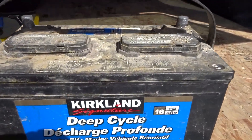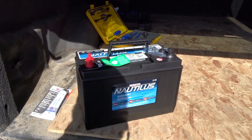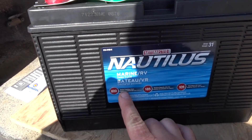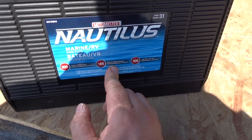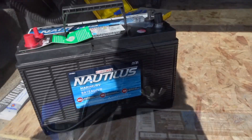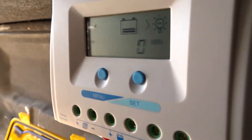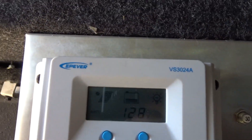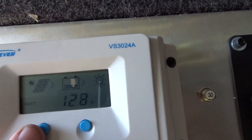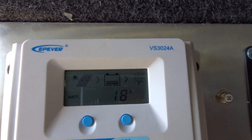That little battery treated me well, but time to get a new one. We're back - this is a new battery: 800 marine cranking amps, 185 reserve capacity minutes, 105 amp hours. I'm not using the posts - it uses those twist-on ones. I'll save the posts for something else. This battery is not quite charged yet: 12.8 volts, 1.8 amps.